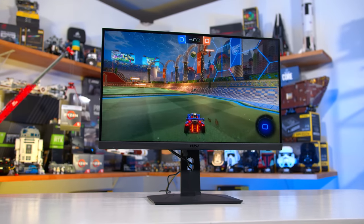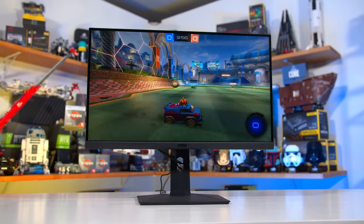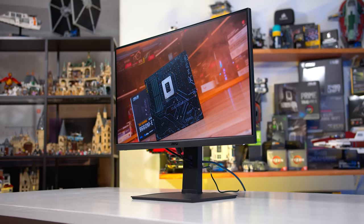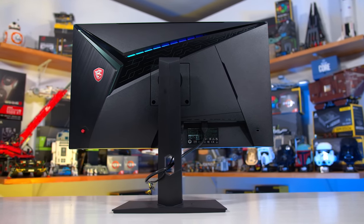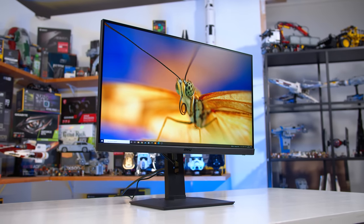With that 2x range, LFC can be activated and you effectively end up with a near-zero minimum refresh rate — it's not literally zero, it's using frame duplication technology which I think is mostly handled GPU-side. It used to be more of an issue back when we had FreeSync monitors that were 75Hz or 60Hz maximum, because if you had 48 to 60Hz you can't use LFC — at 36fps there's no way to duplicate that into a monitor that can only go up to 60Hz.